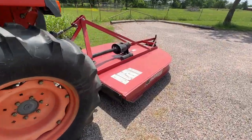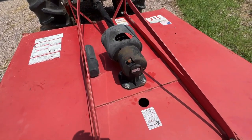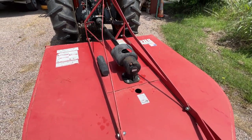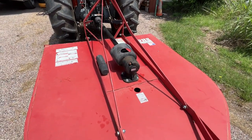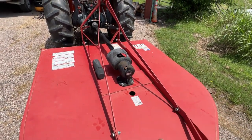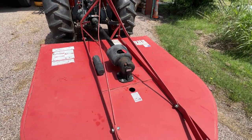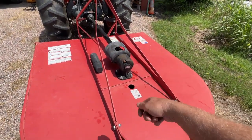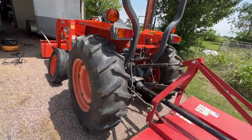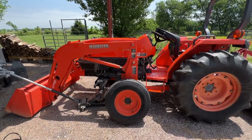I went ahead and checked the fluid level. It's got a fill-level screw at the bottom — you unscrew it and oil is supposed to come out. I'd like to change the fluid but there's no drain plug, and it's thick like 80-90 weight. I've got a suction tool but I haven't tried to suck it out yet. Even if I do, I won't get all the metal particles and dirt at the bottom — that's why I want a proper drain plug. Anyway, it's Saturday, I've got a live later, so I'll see y'all later.